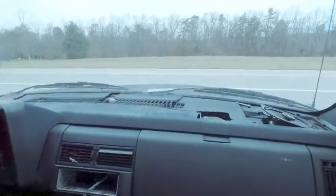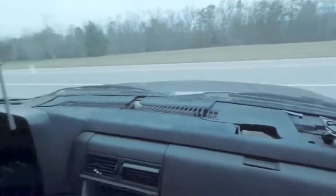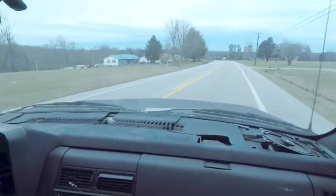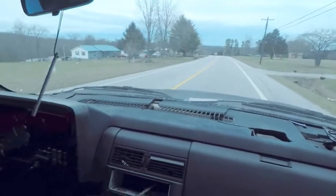Yeah. I guess the pins just got pushed in somehow when I plugged it in. So I pulled all the pins out. They all went clip. I lined it up, slid it on, didn't force it or anything like that. It went on smooth. The plug clipped, so now I guess we're going to take it down the road and see if it actually shifts through the gears like it's supposed to. All right, sweet. Definitely feels better, but let's see if it shifts. That sounds like it's in first.